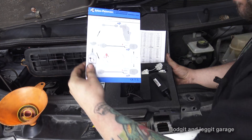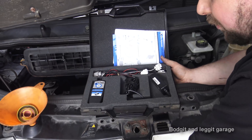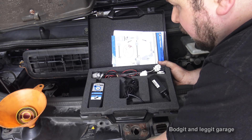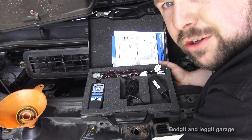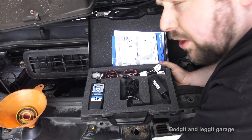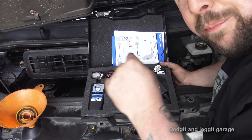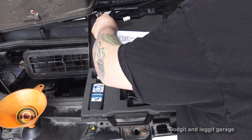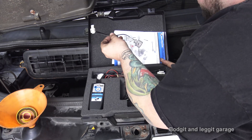There's also a quick guide showing you how to use it. Now Sykes don't say this, but I've actually managed to open and close some idle air control valves with it as well. As long as it's 12 volts you can open and close them and test them. It's not intended for that, but I've done it and it hasn't caused any damage.